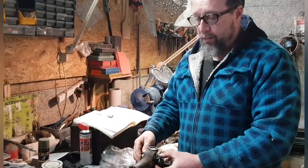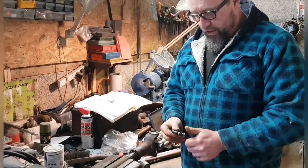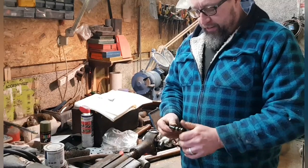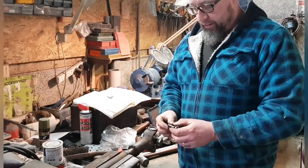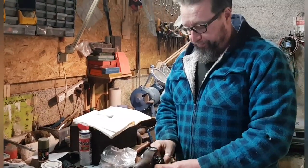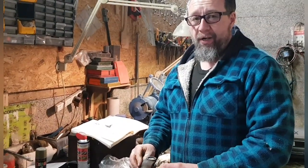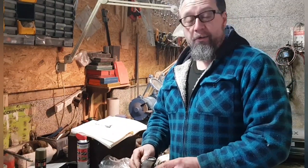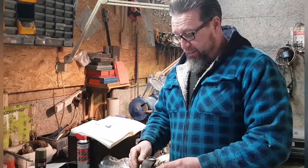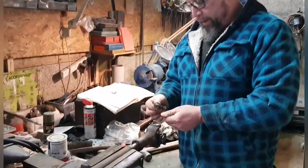There's a few things to do under the Jeep. First, remove the protective shield, the transfer box. I think I'm going to have to whip off the exhaust, but the exhaust is pretty knackered anyway, so it could do with a new one. Once the exhaust is out of the way as well, I can then get to the master cylinder, because the heat shield for the exhaust is in the way and it all needs to come off. So it's probably best it all comes off and I can get to it, do it easier then.